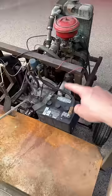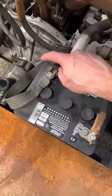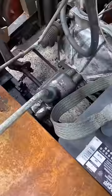It's a six-volt positive ground system, so this is a six-volt battery. The positive terminal of the battery goes to the chassis. Here's the itty-bitty transmission — it's a three-speed, about the size of your hand, and it's a dog-leg first gear. So first is over to the left and down.